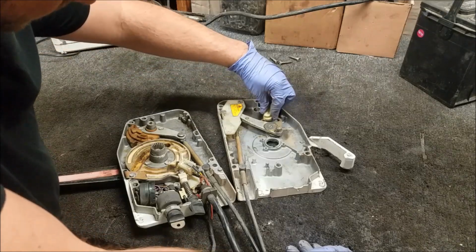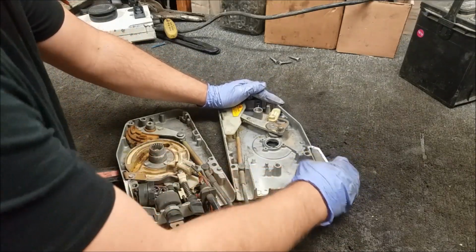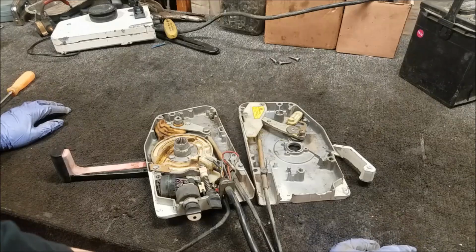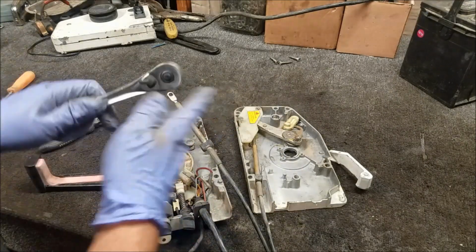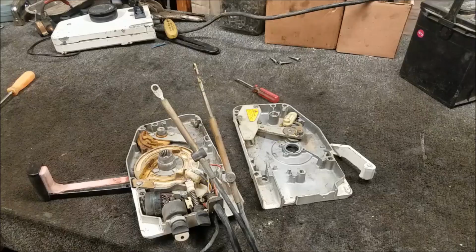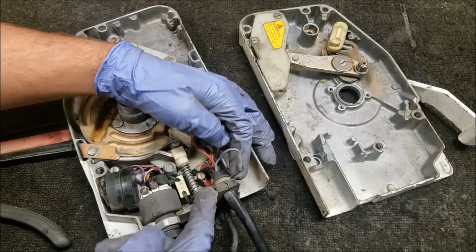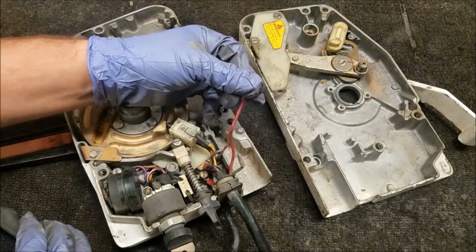Also, apparently, this controller is nearly already apart. So that'll be good. Ideally, what I would do here is fix up this controller just because it's newer. Problem is, this warm-up lever has these two little detent balls, where this model of controller didn't have those. So that option's kind of out. But this controller actually does look a little better. This controller's problem is the tachometer plug here, which you can see in this one. They cut it off and kind of direct wired it into the dash. Apparently they didn't want to buy a $20 harness. No big deal. But that's going to bug me for the rest of my life, so I'm going to get that fixed and use this one for parts. So, stay tuned. This one's already nearly apart, so let's get that one open first.